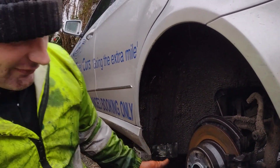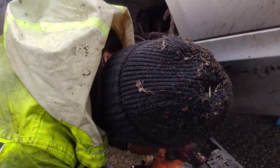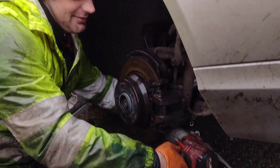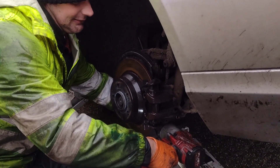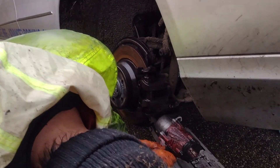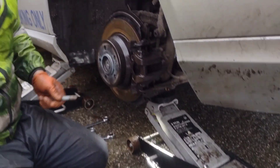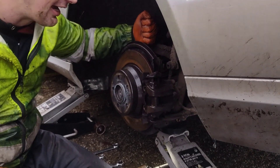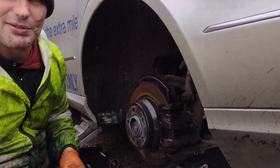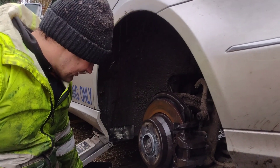So now what I'm going to do is stay out the way of it because I know that it comes up. I've got a jack there but I don't need that just yet. So we're going to take this one out right here — I've got the 21mm, I'm not going to stand in the way. That's the nut off one side, we've still got this bolt to come out here. And if you saw that move, that's what got me on the head last time when I was doing a spring. So that's the outer one.